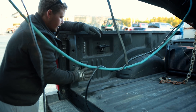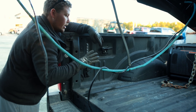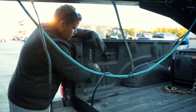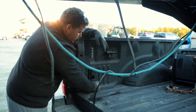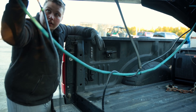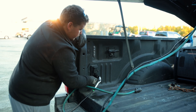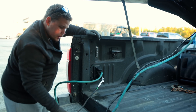So this is the interesting part — the extra stuff. If your truck is equipped with the Pro Trailer Backup Assist, the TPMS, and all those fancy trailer features, you're going to have these two plugs. This one here is your standard 7-pin — what all trailers have been coming with for years. But this here is the extra one, where your extra plug goes in. You're going to do it first because it's on the bottom. Plug that in, make sure it's clicked in — love how positive that feedback is. Then take your regular 7-pin, and now everything is connected.